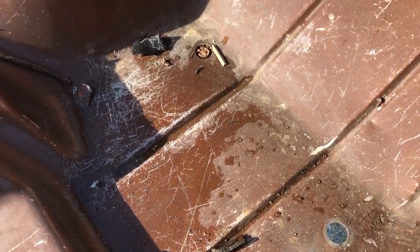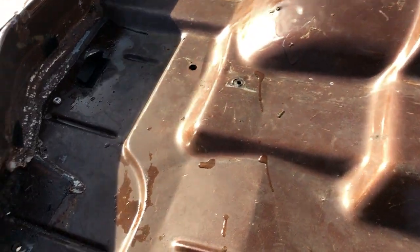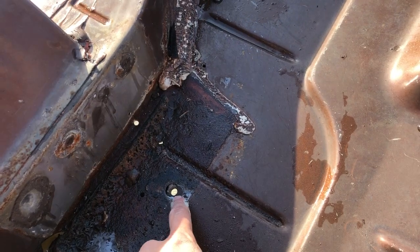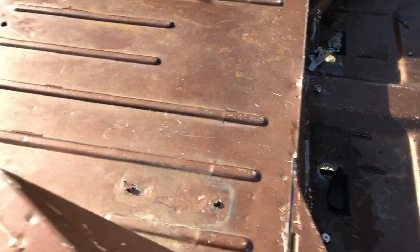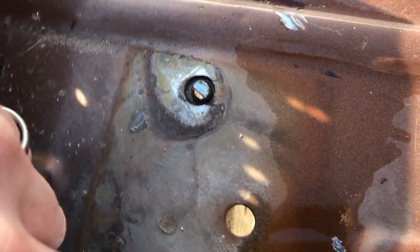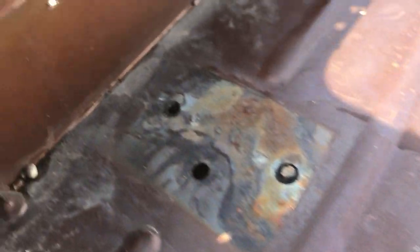Floorboards — obviously a very important part as well. They're easy enough to replace, but if you don't have to, you don't have to. Nice clean holes where the roll bar went, nothing broken off there. These are all areas they tell people to make sure to inspect before installing the roll bar, because they do trap moisture. This one does have a broken bolt, so you'll have to extract that one. One of the guys probably got lazy. There's another one there — pretty good head on them, so you'll be able to get those out with a left-hand drill bit.